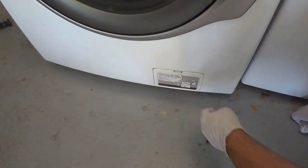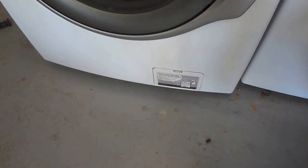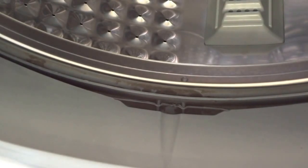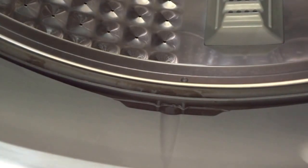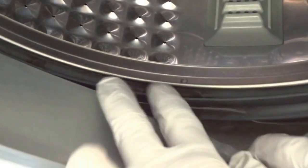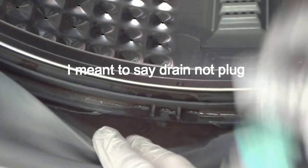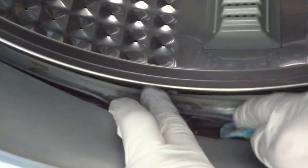The next thing has to do with the inside of the door. This is something I figured out on my own — I couldn't find it in any manual. I don't know if this is specific to Samsung, but inside this door gasket you'll see there's just nasty funk in there. There's supposed to be a plug here that lets things drain out. This stuff smells so bad, and I can pretty much guarantee that the vast majority of the smell in your washer is coming from this little area right here.